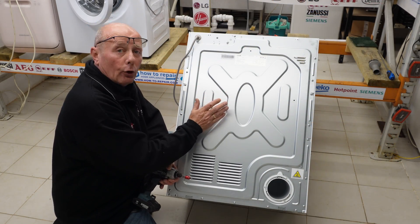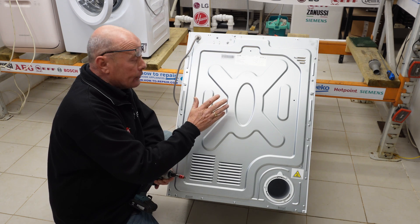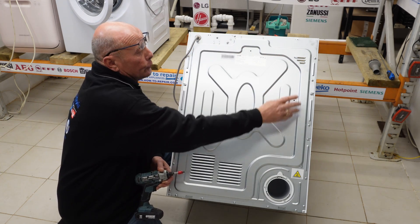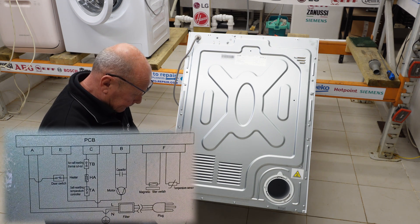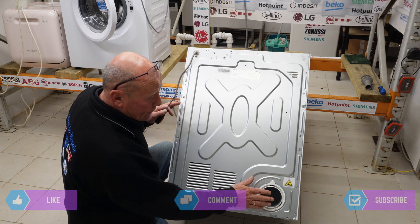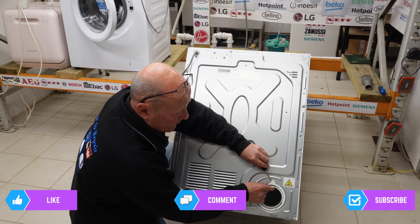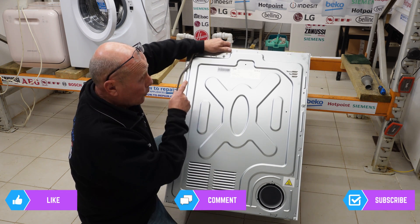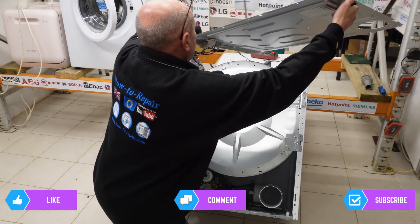The manufacturer is quite thoughtful — on the back of your machine there is usually a wiring diagram showing you the actual electrical circuit. I will take a copy and put it in the description for you. You don't need to remove all the screws — there are a couple at the top; you only need to remove the ones going through the back panel. You can actually take the back panel off without taking the vent connection off, but to remove it just lift and twist. Then the back panel can come away, but make sure the wiring for the thermostats is disconnected, otherwise you won't have enough space to turn the plate around.